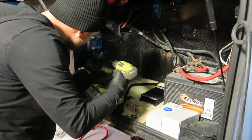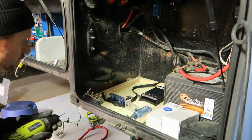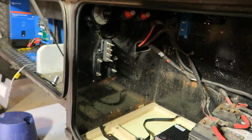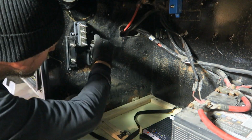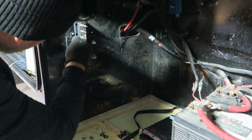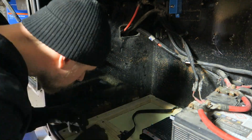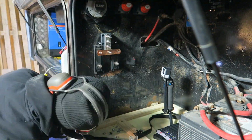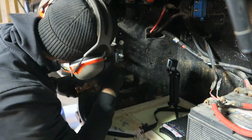I use one cutoff switch for the inverter, the big one, the MultiPlus. Then I use another cutoff switch for all other DC loads, including my Phoenix inverter. And then I use a third cutoff switch for all the charging from the solar panels and from the DC-DC buck boost. On the DC distribution side, I use a BatteryProtect 100 amps. And on the charging side, I use a similar BatteryProtect, but it's mounted in reverse, so it works for charging.